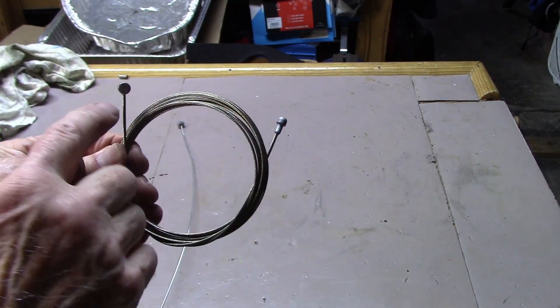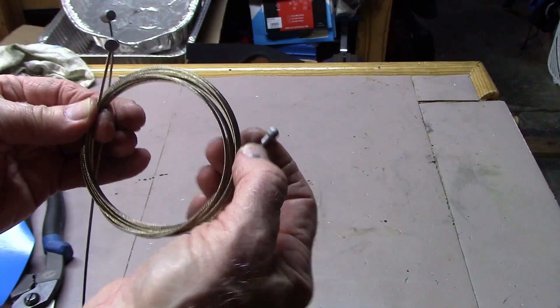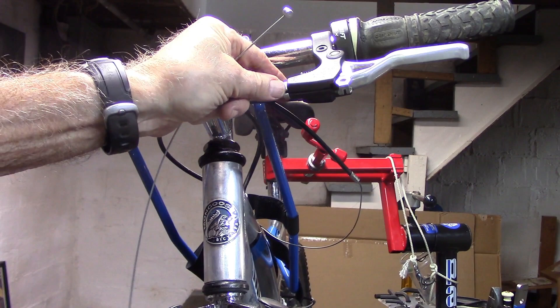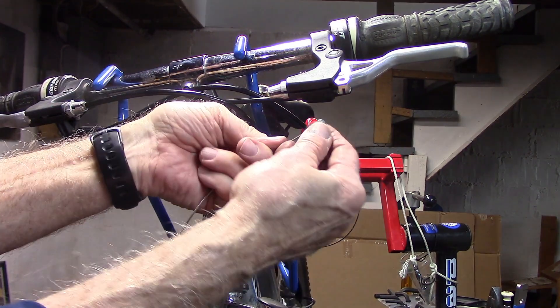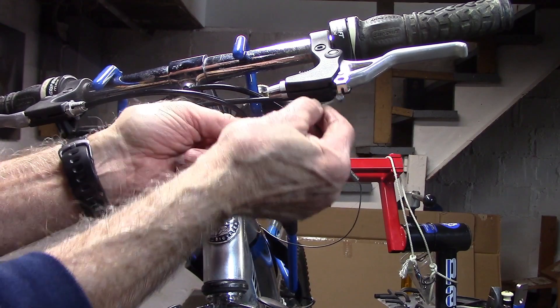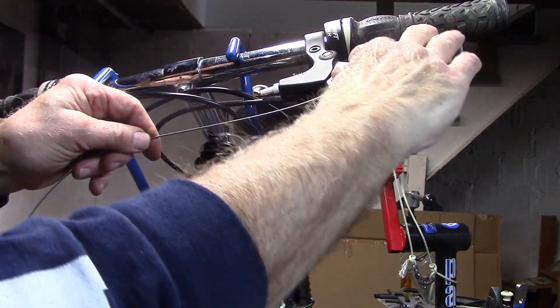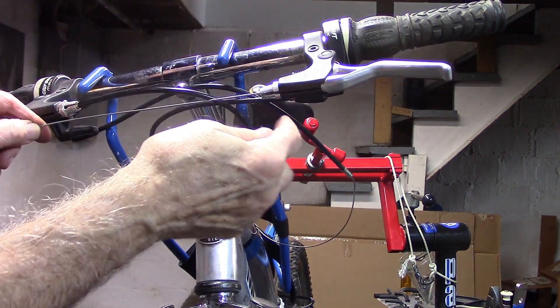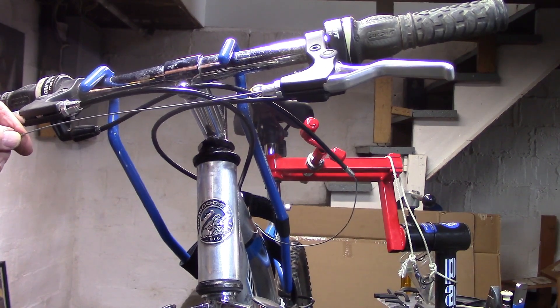Some brakes will come with two different ends depending on the type of brakes you're using. This is what we took out over here, so we'll need to cut off this end and install the brake cable. Hopefully you can see that in the brake handle itself there is a groove where we're going to place our brake cable. We'll line it up with the lock nut and the barrel adjuster and slide in our brake cable. We can pull it back, let go, and turn it a little bit so it doesn't fall out. Now we're ready to install this in its housing.